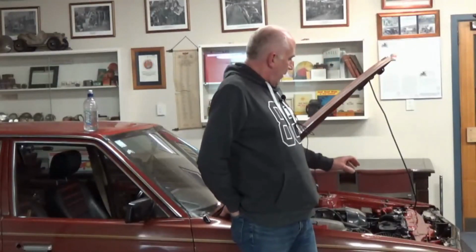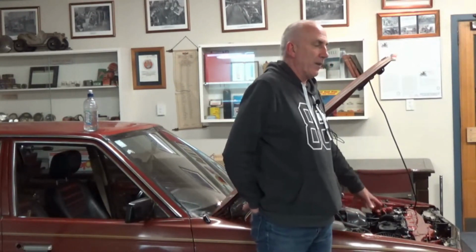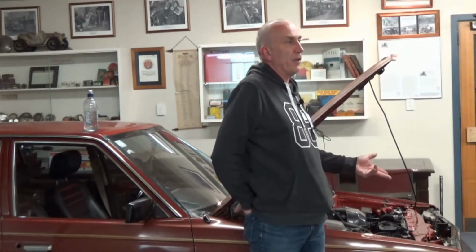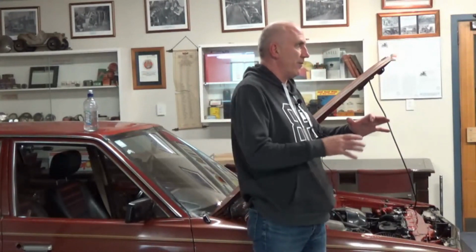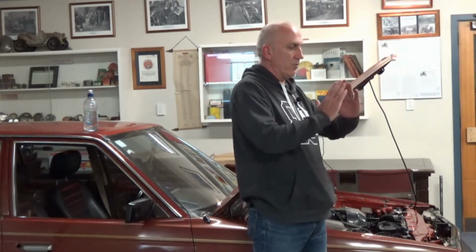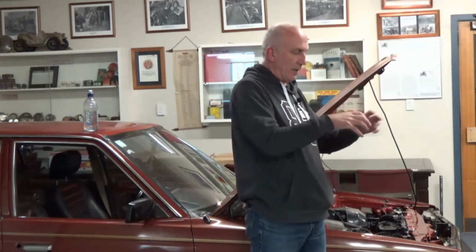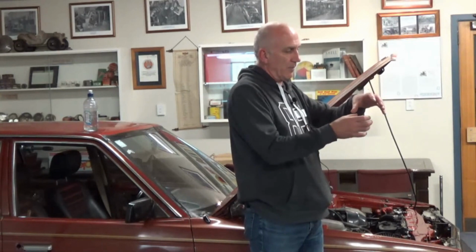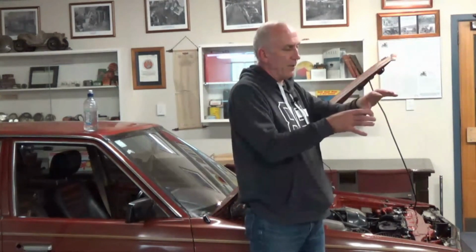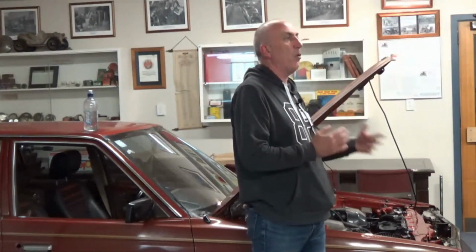Correct. Yeah, so what's interesting is the Toyota Altezza's got quite a big plastic airbox that fits in this corner, and it has a hot wire airflow meter, and it's integral with the airbox. The way I can describe it is it's kind of like a triangle pyramid type shape, and it's got the airflow meter in it, and then it comes out basically at a 90-degree. You've got the airbox, and the airflow meter is at a 90-degree to it. And you just look at it and go, that's appalling for flow.